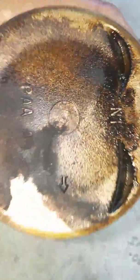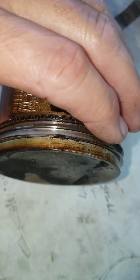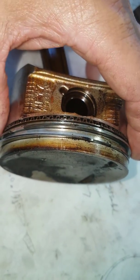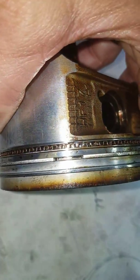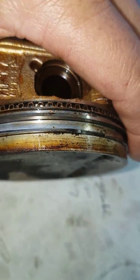I pulled the piston out. That's the driver's side — arrow points to the driver's side. There was a question about where the rings were lined up. They weren't that far off — they were probably like this. The oil control ring gap was there, so I don't think it was set up very good as far as that's concerned.